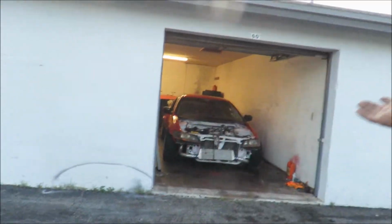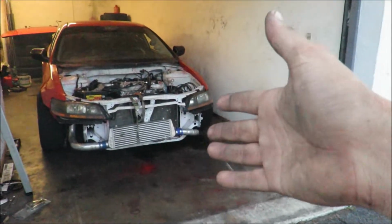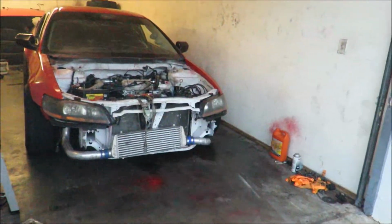So it's just really gonna be go nut and bolt check it, make sure everything's snug and tight, make sure none's thrown off, things like that. But it feels like the tension rods or something are loose, or radius arms, if you want to call it that, because the wheels move forward and back, which it has aftermarket polyurethane bushings on it. So maybe they just gotta be tightened up, but I know that messes with caster. So if I tighten it too much, obviously it's gonna throw off the caster of the car. So I just wanna make sure everything's good and tight down there, and we'll go from there.